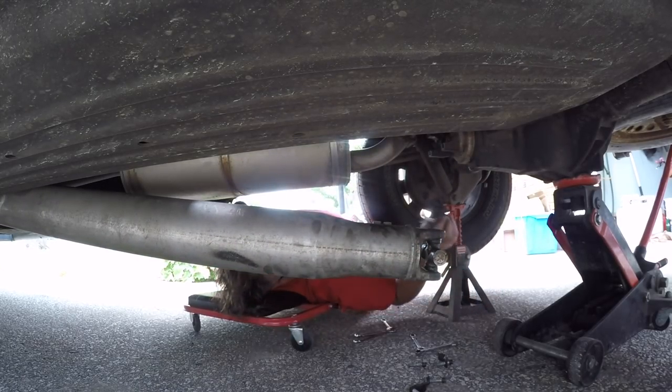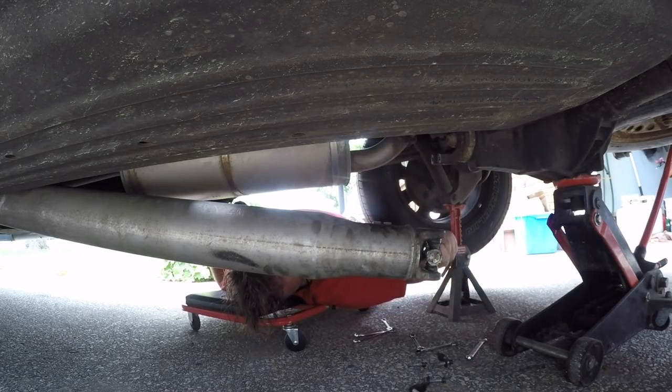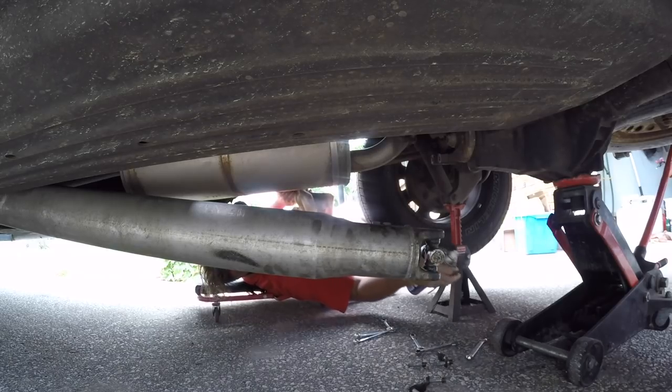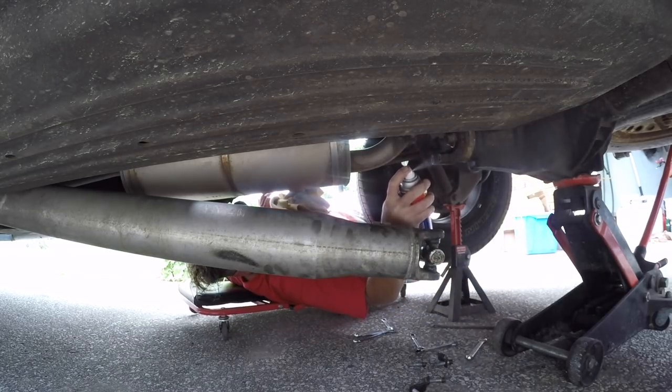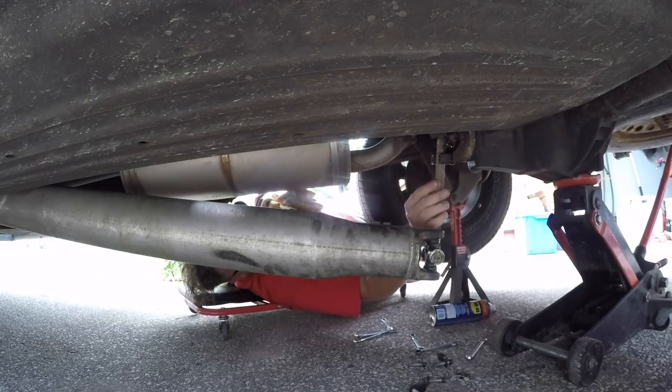That part's off. And as I see right now, it looks like it was seated pretty good. The U-joint still feels good. They're brand new, they'd better. That one feels good. They feel great. So now what I'm gonna do is spray with some WD. I'm just gonna take a little file with a round edge on it and just feel it. Make sure there's nothing on there, boys, that will cause it to be cocked. Just a little bit, I don't want to take off any material. You just want to feel for lumps.